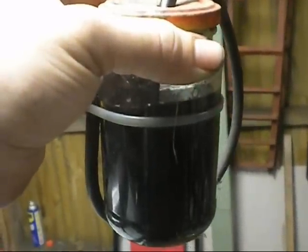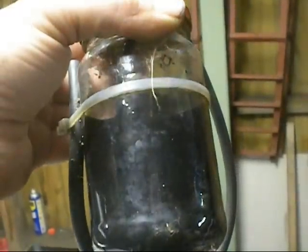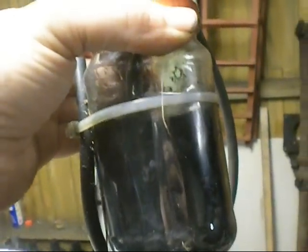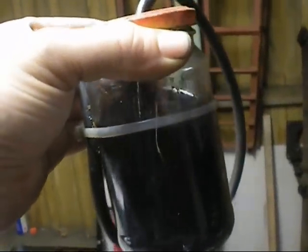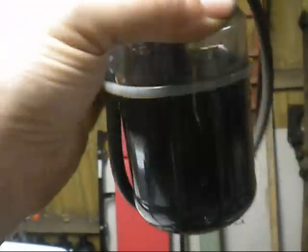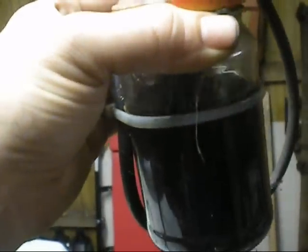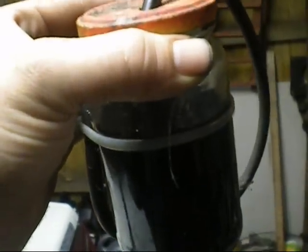Yeah, adjusting the timing helped, but it's just awful. I think it's destroyed itself. It's had new injectors, new glow plugs, they have everything done and it still chugs a bit and smokes like you wouldn't believe and sounds like, well, you heard it. That's probably the problem. I think they've been using biodiesel. I did ask them, they said there's normal diesel in the tank, but that's what came out. So, I better explore a bit further.